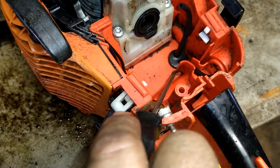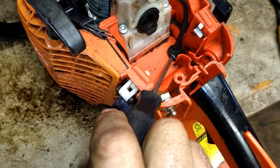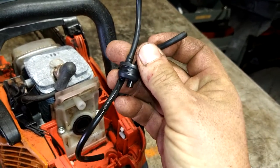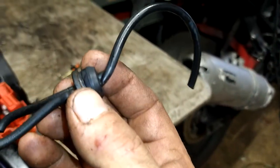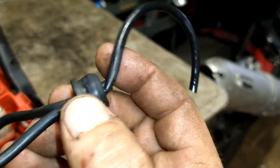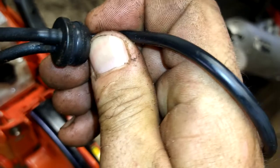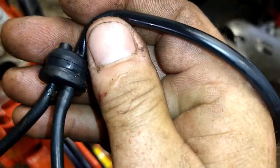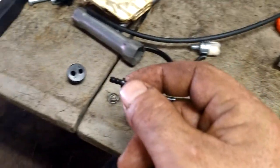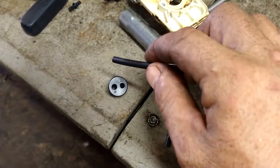Give the carburetor a good rinse. Then take a flat screwdriver and stick it underneath the rubber grommet and pry it up — it takes two hands. Pull it right on out, then remove the fuel lines. So I found out what the actual issue is: the fuel lines weren't bad, but the line was kinked over — it got soft, no holes in it, but it wasn't letting the fuel through.